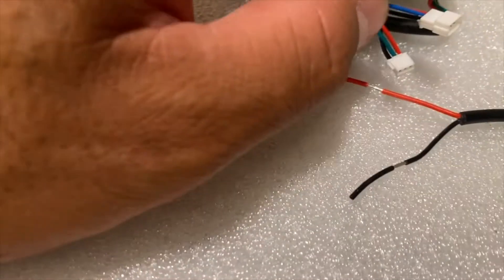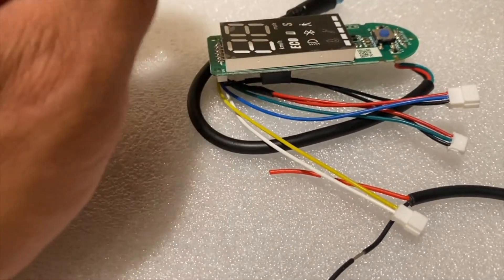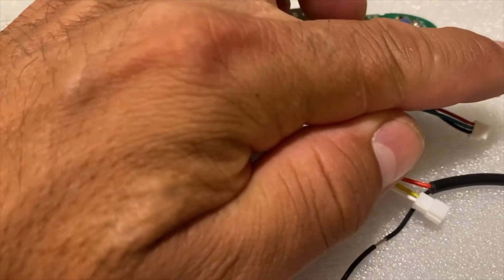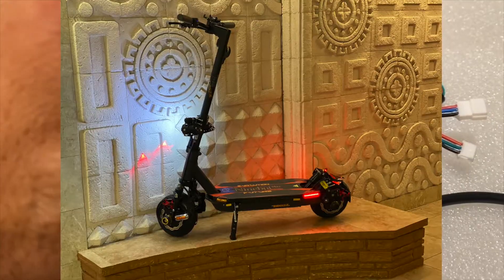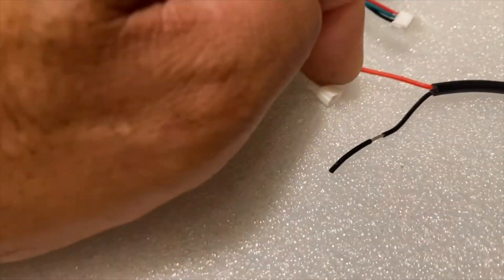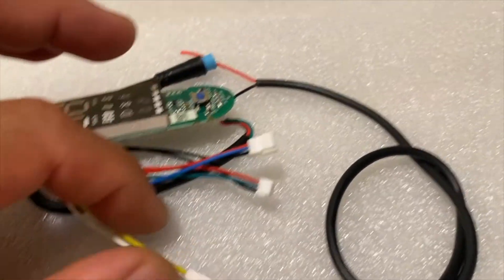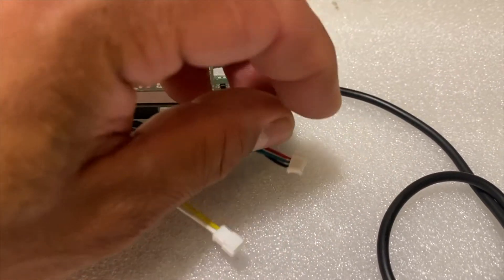Then connect your throttle back again, leaving the brake — this is important. The reason the controllers get burned with motors is because of this connection. So you're not going to connect the brake anymore. And that's why I said you need these brakes and motors — it is because you're eliminating completely the braking part in this connection. Once it's done, once you have the black cable connected to the blue and the red one connected to the green, and you have the wire running through in the position you want toward the second dashboard, wrap it up with tape properly so it doesn't move, and do not connect the brake back.